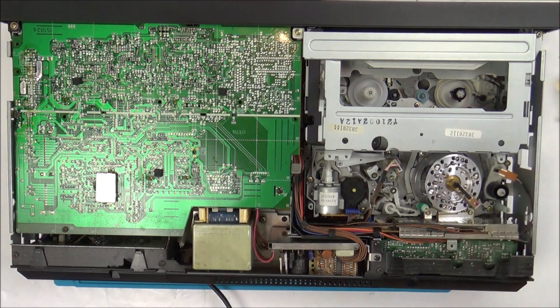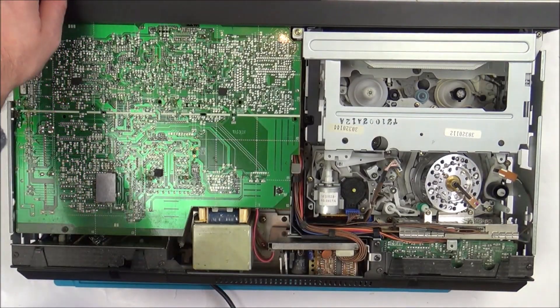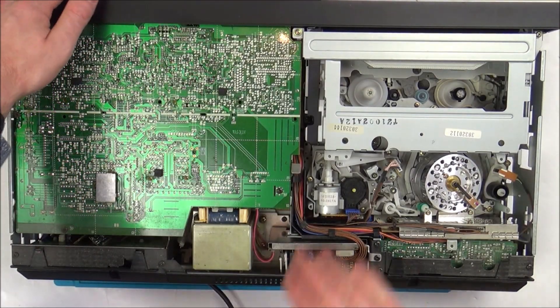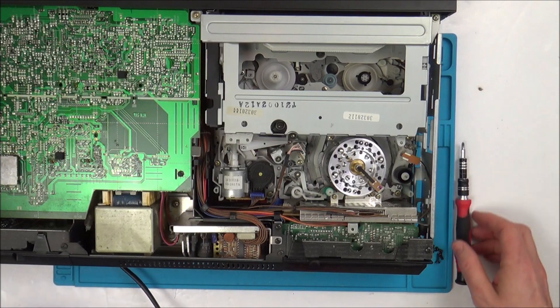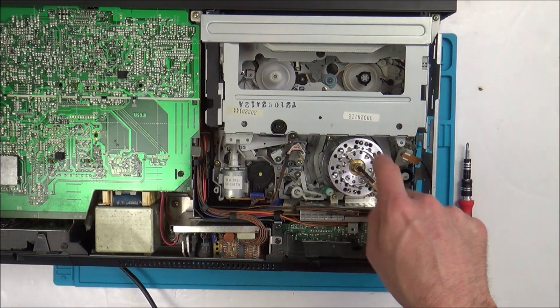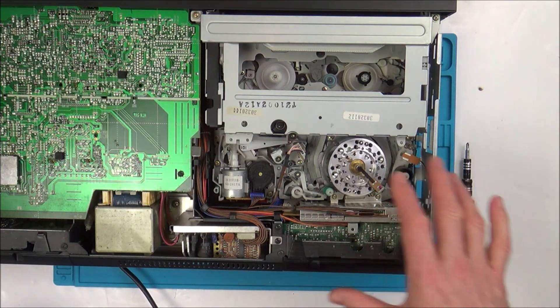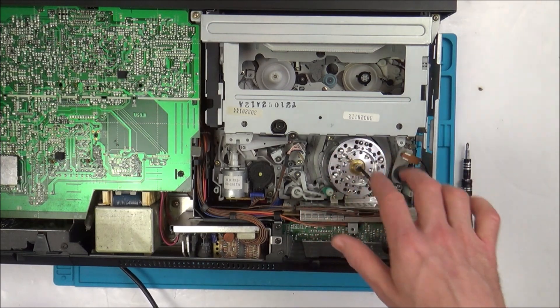Right, look at the little grill there. Wow, here we have it. I've got it unplugged at the moment, but the capacitors could still be charged — I'll hit the on/off a few times to drain it. So obviously we're dealing with this mechanism in here. Let's try to have a look to see what's happening. Whatever is moving it around is obviously not moving it. It's either going to be a mechanical issue, or it might not be getting the signal to move — in which case it could be electrical.